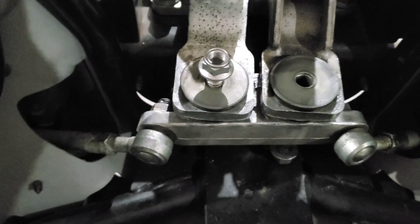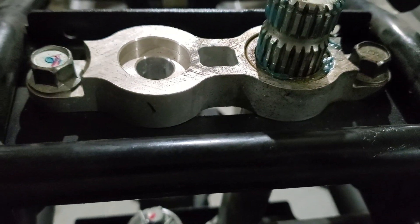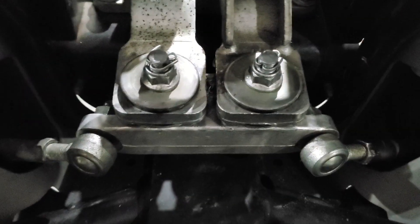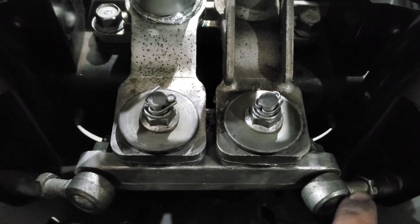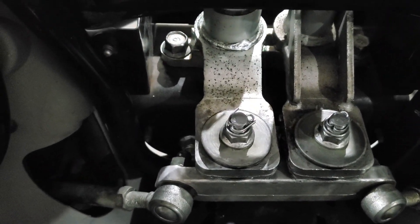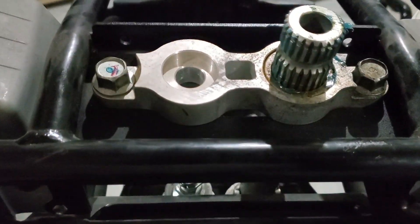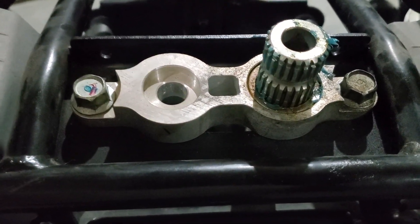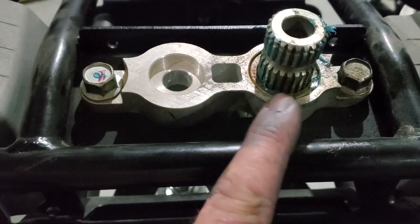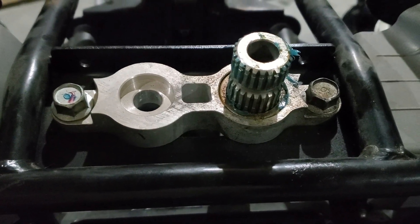One thing I forgot to mention: while I had this all apart, I took the opportunity to clean all these pivot points really well and check them for tightness. I also greased up here at the top — there's a roller bearing inside of there. So I'm going to go ahead and tighten these two bolts back up. I also checked the tightness on my tie rod ends and found both of those to be slightly loose as well, so I tightened those up. Everything looks good under here — definitely took a whole lot of the slop out of it. Now we're going to move up and put on the next three plastic washers that go up here. I cleaned this up and re-greased the roller bearing inside.